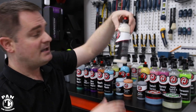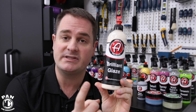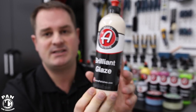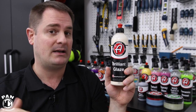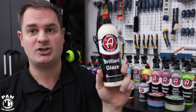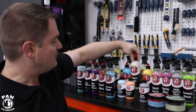If you want to add a bit of pop, a lot of gloss, and give that wet look to your paint, you're going to use a glaze. Adams has their Brilliant Glaze, which uses fillers. For those who don't want to go through paint correction but still want to fill in some minor swirls and scratches, these fillers do that work. Keep in mind you're not doing true paint correction with a compound or polish — you're masking the imperfections. But it's a quick way for those who don't want to spend time polishing with a DA polisher, and it serves as a bonding agent for your layer of wax or paint sealant.